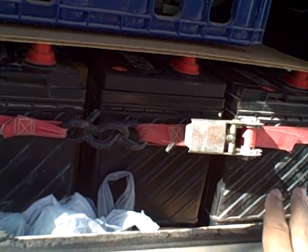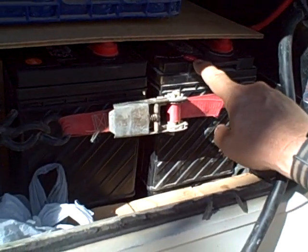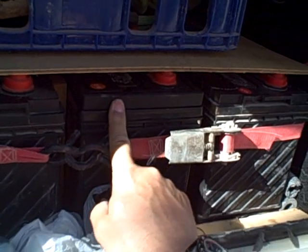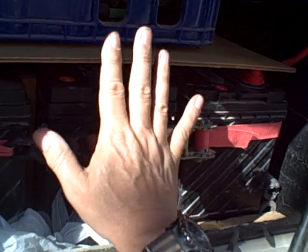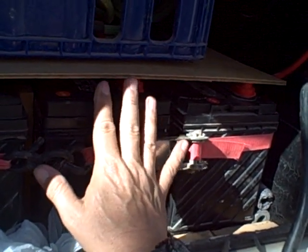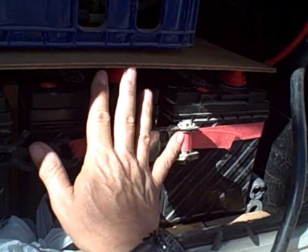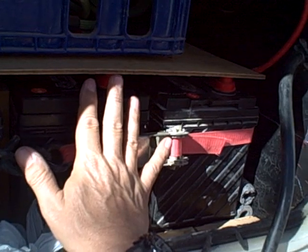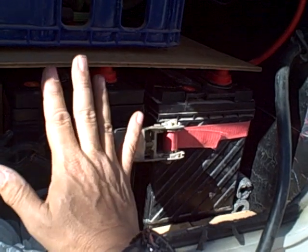The question is: what kind of use do we get out of these three batteries? We've had them since April 2014, so just about five years. I'm making this video because one battery actually went bad the other day, so I had to replace it. These batteries are about 90 bucks each. Running everything inside except for the air conditioner — which is a 21-amp pig — but running the TV, the microwave, the coffee maker, just living like normal people, and running the fan on the AC but not the AC itself.